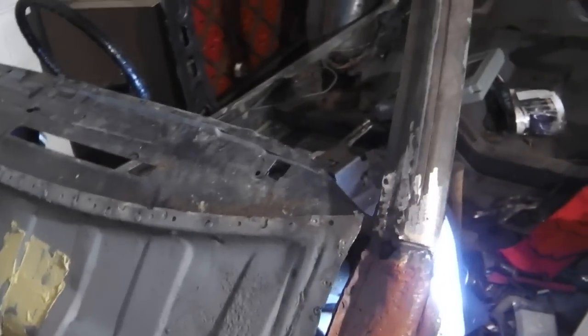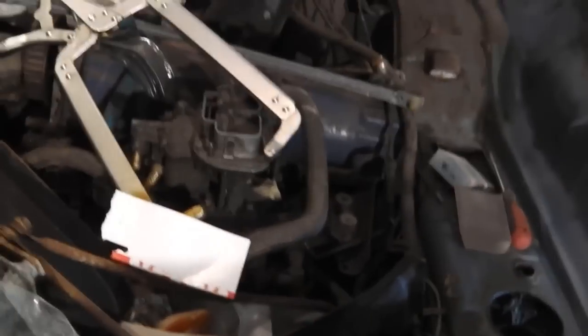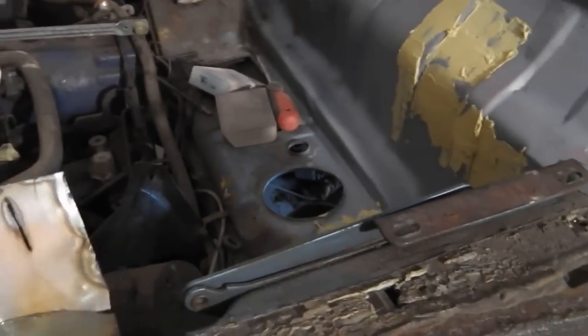6th of Jan. We are still repairing the bulkhead. I've had to replace more than initially thought, because look what we got, some pitting on the lower bulkhead, which only showed up when I really vigorously cleaned it. However, I should have spotted the clues on the other side, really. When you're looking at a pitted surface, it's often the case that it's about to break through, like it has done here. Although not always, depending on the gauge of the metal, I suppose.